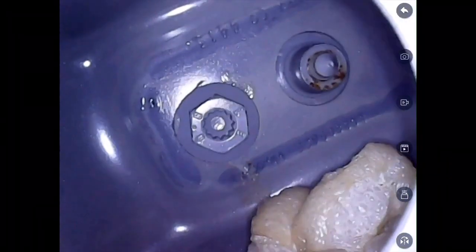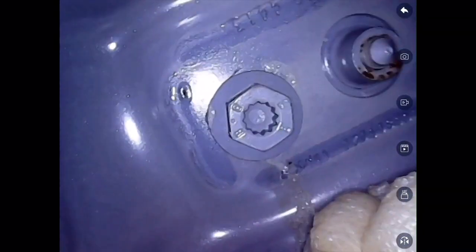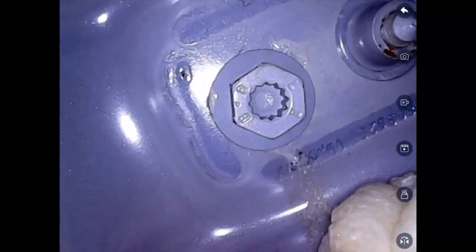Alright, so if you go now inside here, you see the actual hood latch inside the cabin of the car and the lower A-pillar. If you go past that, behind that basically, you see a hole there. And in the hole there is where the screws are. Basically just the one screw for that car hinge. You unscrew that one screw, and you come around on the outside of the car to the A-pillar door area here.